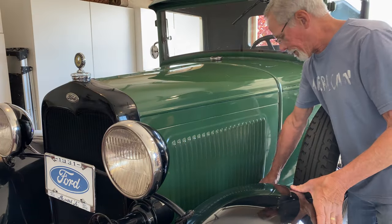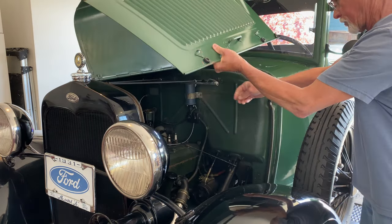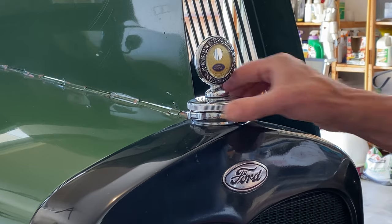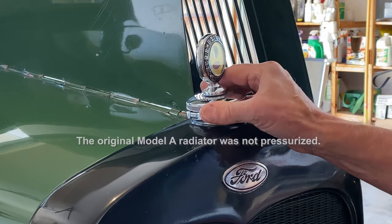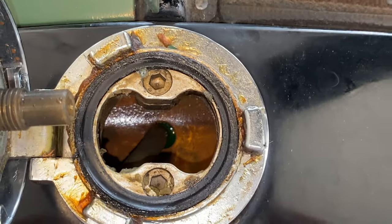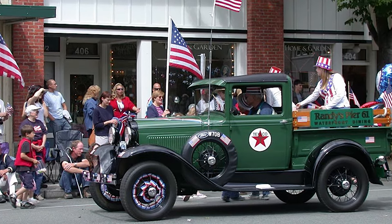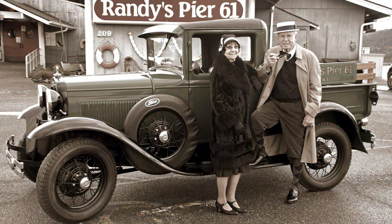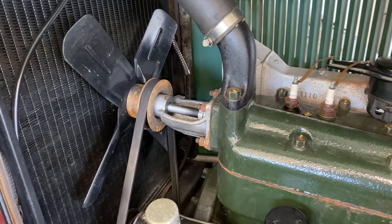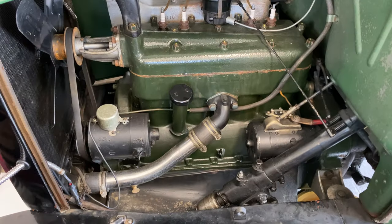Let's open up the hood. Open up the radiator cap to release any pressure. It's a little bit low but not bad — I can see it beyond that little opening. My dad often drove this Model A in parades in Anacortes, Washington, and he would sometimes have problems with overheating. The best solution my dad found was to replace the three-bladed fan with a four-bladed fan.